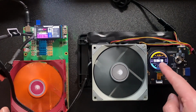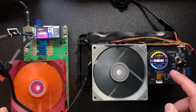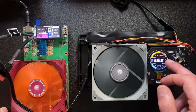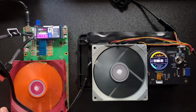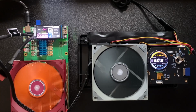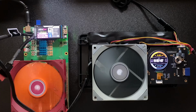This is still actually running at 4.26, which is great efficiency, but I'm assuming that it's going to drop. So let's leave it for a couple minutes and then let's see what it ends up at. I'm assuming 3.5 is the terahash that it's going to end up at. So you can see that after you let it run, that's 3.33. That gives us an efficiency of 18.31.